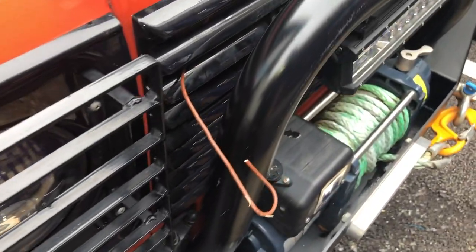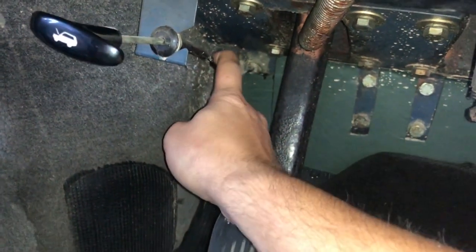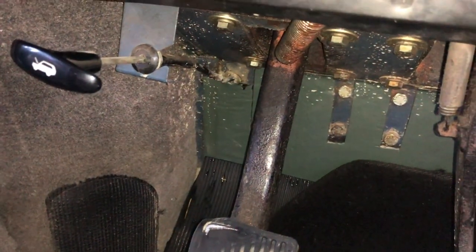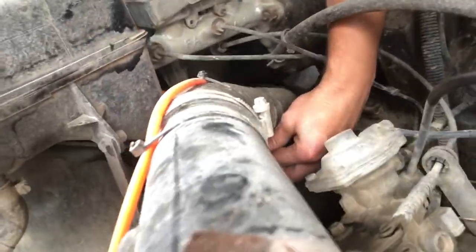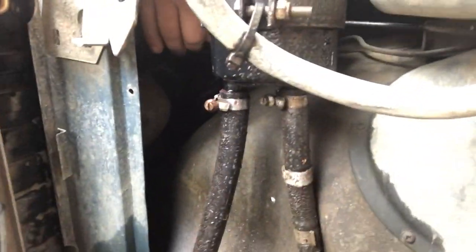As you can see, my current arrangement for opening up the bonnet is this bit of cable since it broke a few weeks ago, so that's what I've been dealing with. My bonnet release cable is completely screwed and it passes down there through that little hole. There's just a little locking nut there holding it into this clamp. We'll undo that, pull it out first, then go over to the bonnet and disconnect it from the bonnet side. The current cable comes down through here, up along here, through that hole where my finger is, up through here, around underneath the coolant bottle, and then through to where the bonnet release catches.